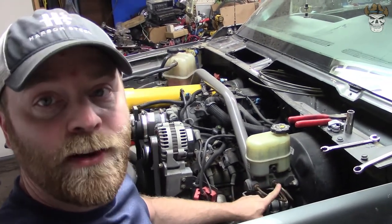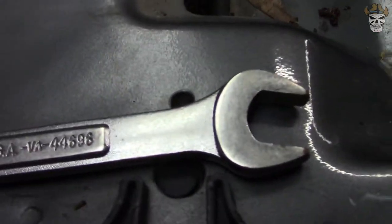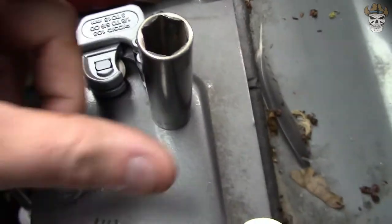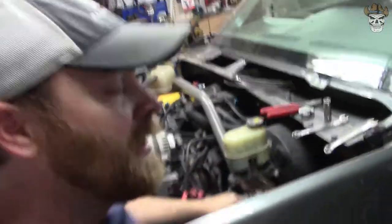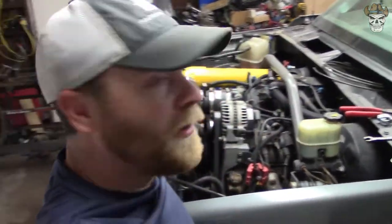I have a few options for removing the brake line nut. You can use an open-end wrench, a line wrench, or since we're not keeping any of it, I'm going to use any means necessary. I'm going to take a socket, pop it onto it, and break it loose. That's a good method to use because since we're not saving any of this, it makes it a heck of a lot easier to remove. So let's start removing all the front lines and then we can start bending our new line.